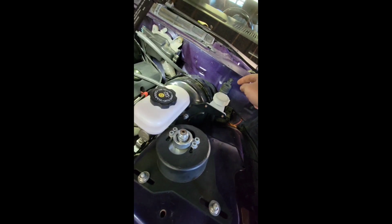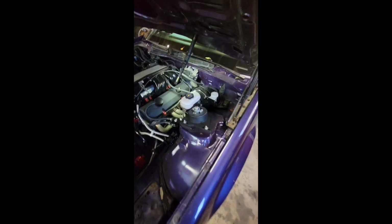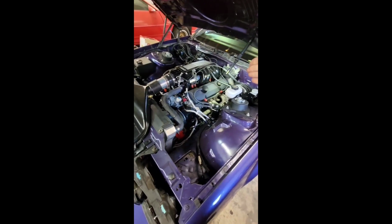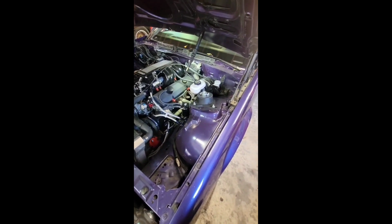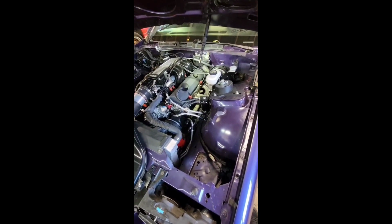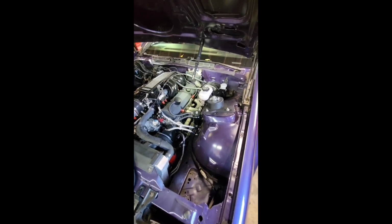Now if I take this relay and I disconnect it, I'm going to shut off the fuel pump. It's no different than disconnecting or removing the fuse for the fuel pump. So when that relay's disconnected and the switch has failed, sure. The only way that you would actually have a shutdown of the engine is if your relay's already toast and it's running on the oil pressure switch. The oil pressure switch will continue to keep the fuel pump circuit alive, and the engine running. So what you'll see if your fuel pump relay is bad is extended crank times. That's pretty much it. That's the only difference. Whether the pump primes or doesn't prime, it doesn't really matter. It just reduces the crank time.